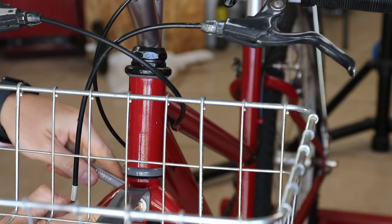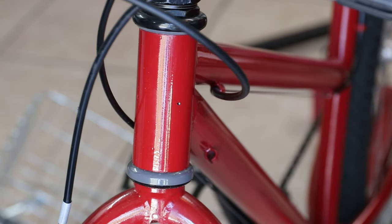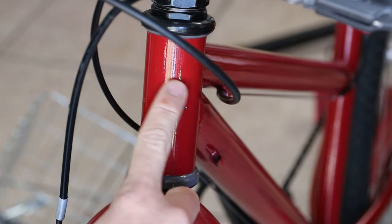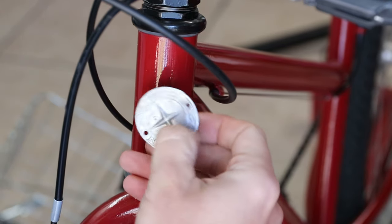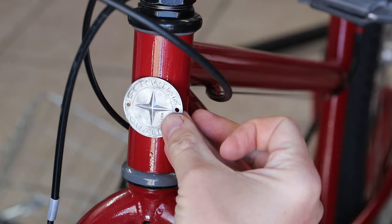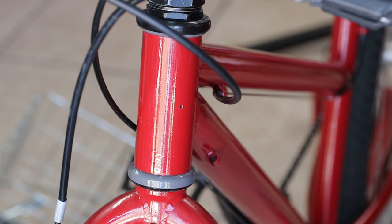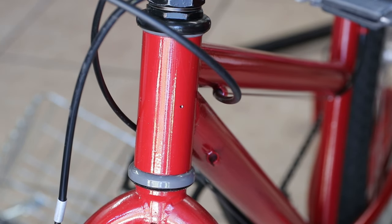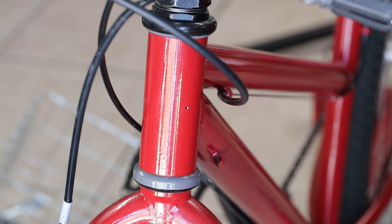The first thing I'm going to do is get this basket out of the way so we can access the head tube. This before was using pop rivets to hold the original badge. I did flatten it out, removed the paint — it kind of looks cool. Problem is I don't have a pop rivet machine that'll do rivets that small, and I'd rather have bolts that I can unscrew and screw back on. I'm planning to drill and tap these two holes so I can change the head tube badge out anytime I want easily.